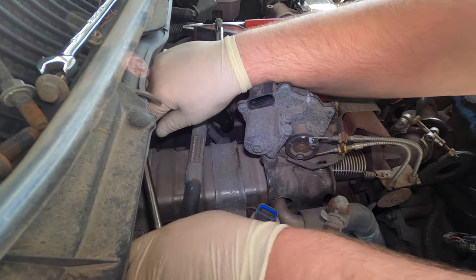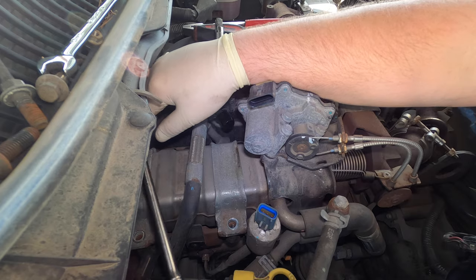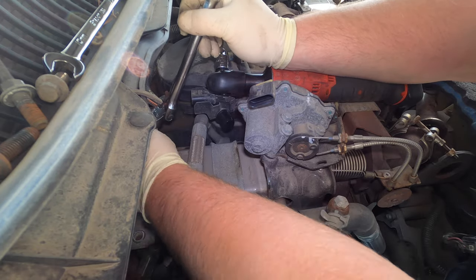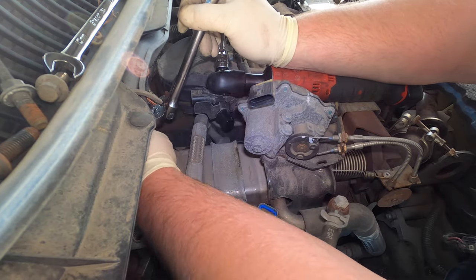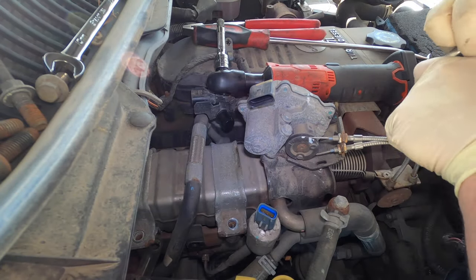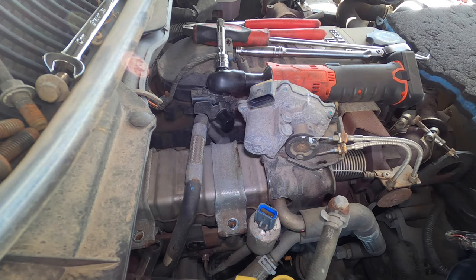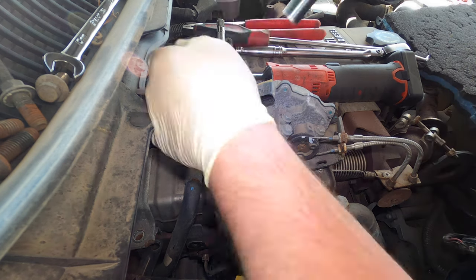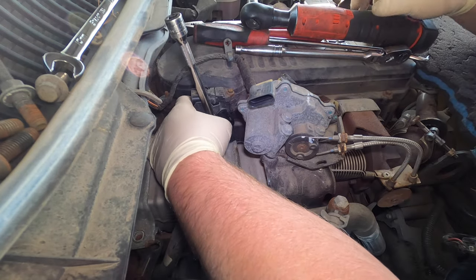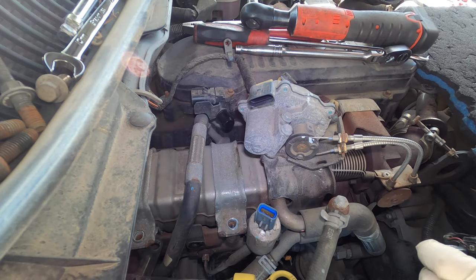Even though these trucks are equipped with a coolant level sensor, people just continue to drive. You can always add water if you're in a pinch - if you're stuck somewhere and you've got to get out, put water in it as long as it's not freezing outside and you don't let it sit and freeze. Just make sure you drain it out afterward and fill it properly. The general rule of thumb is 50/50 - that's what I aim for here in Southern California.